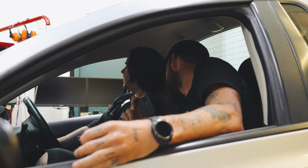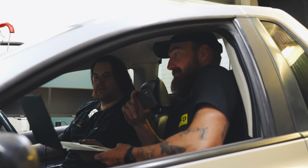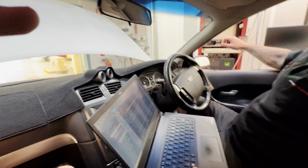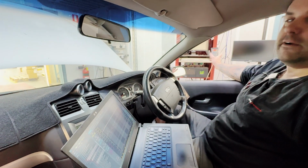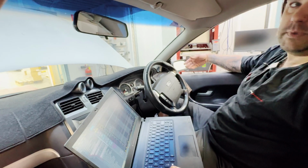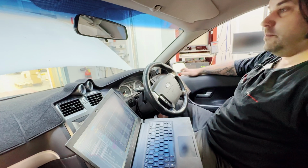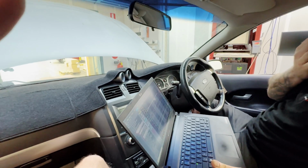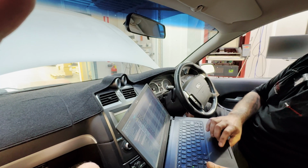Yeah. I'll tidy up the fueling and see where the timing's at, and we'll leave the boost sitting there. But then you've got this sort of trade-off between boost and the ignition timing. So I can lower the boost, run more ignition timing, and actually make higher power. And it won't be as much heat, because the more boost you're putting in, the more heat being put into the motor. Not that the intercooler system's going to have any issue with that. No. But we don't want to bend rods either. Exactly. If we can drop the cylinder pressure and make it more efficient with timing, then that's it.